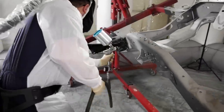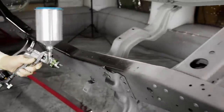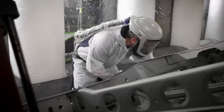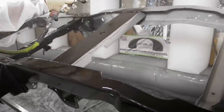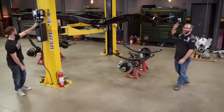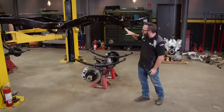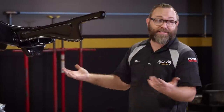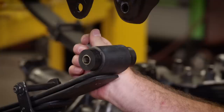This paint has to be applied in two wet coats with at least 30 minutes of flash time between each coat. It can be brushed on if you prefer, but spraying provides a nicer finish in our opinion. We're using an HVLP, or high volume low pressure gun, with a 1.6 millimeter tip. Now I'm not the paint body guru around here, but this is one of those tasks I feel comfortable attacking on my own. The paint's dry on our chassis now and we've got it back in here and it looks fantastic. Really like the way the finish looks — it's got that nice satin finish and it's super heavy duty, so it's going to make this chassis and this build last a really long time.